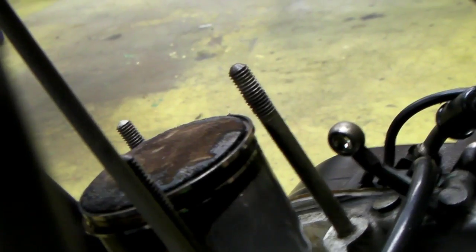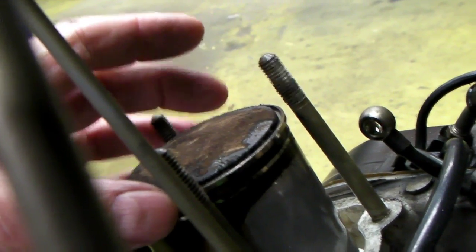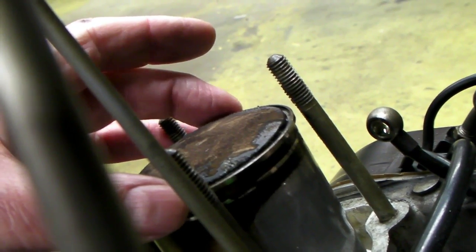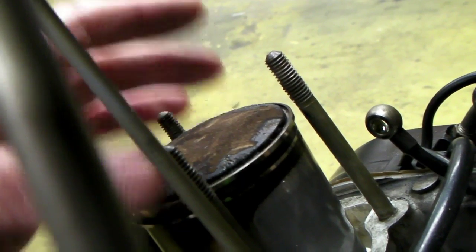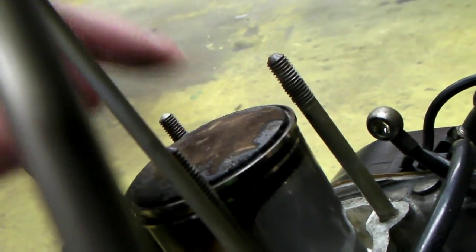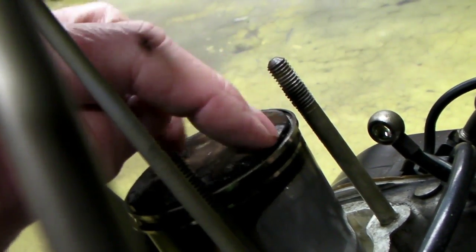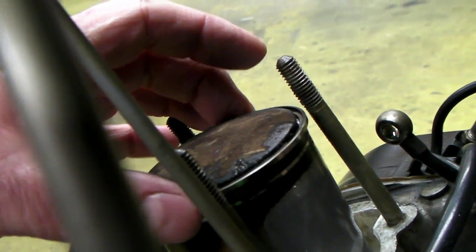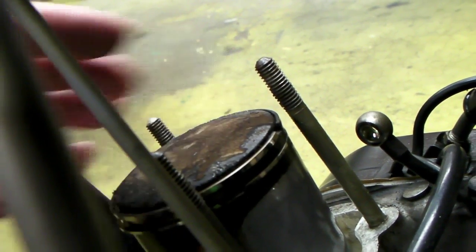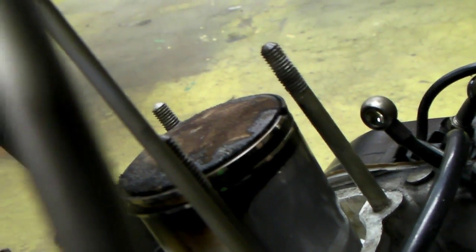Always put the same ring on the same cylinder because they're worn together — they're matched together. These are the original rings on these pistons, which have been in there since probably about 6,000 or 7,000 miles is when I changed them and went to this new stock. I changed them not because there was anything wrong with the old ones, but I knew these Dykes rings are much less apt to get stuck, and I wanted those particular kind of rings, so I bought those from the Yamaha dealer.